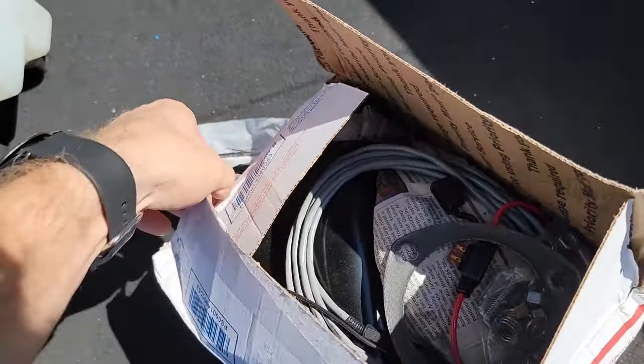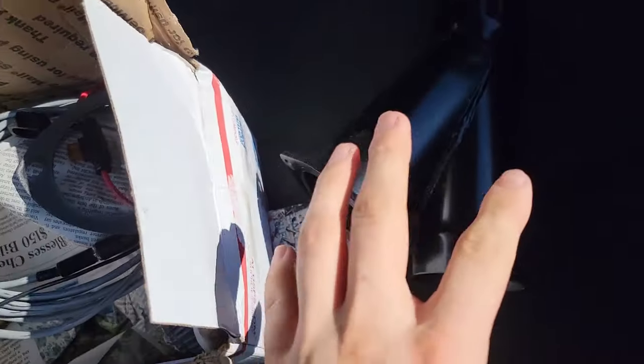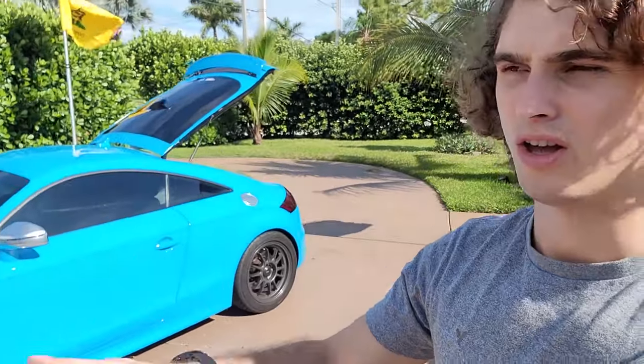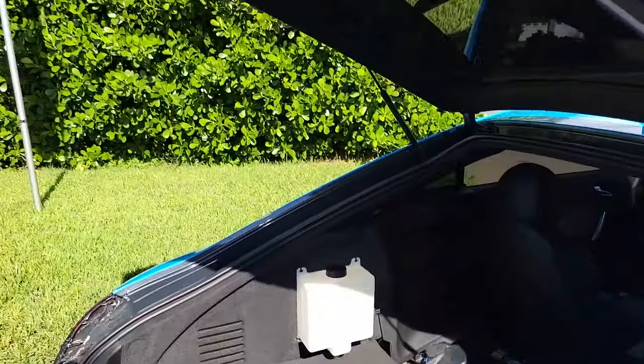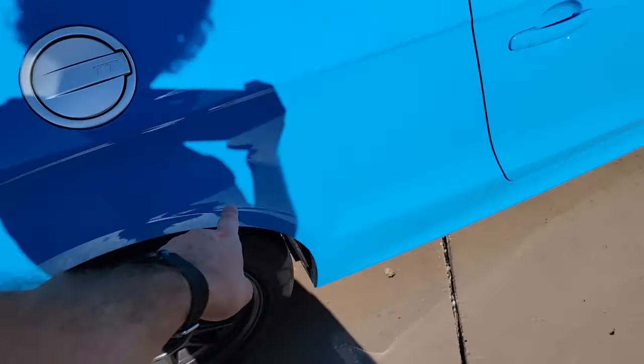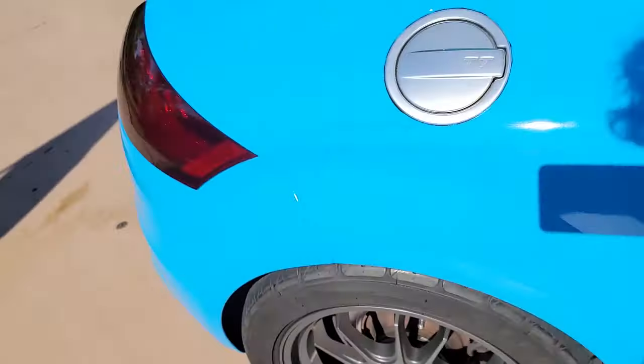I think what's happening with the TT is — I have the same turbo, the same intercooler setup, everything is the same on the TT compared to the GTI — but for some reason on the TT, the turbo seems to be struggling to put out the same amount of boost. It's kind of topping off around 31-32 psi, which is good, the M500 is awesome, but this car only has a two-and-a-half inch pipe going to the exhaust, and the downpipe is two-and-three-quarters.